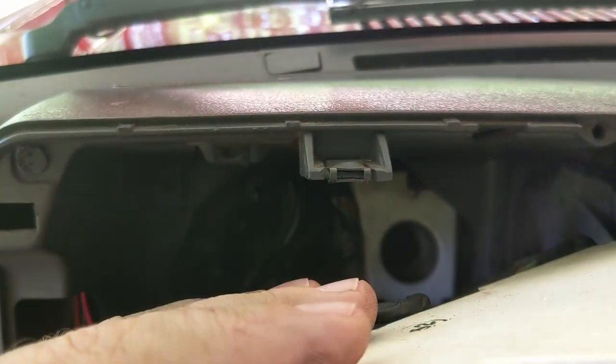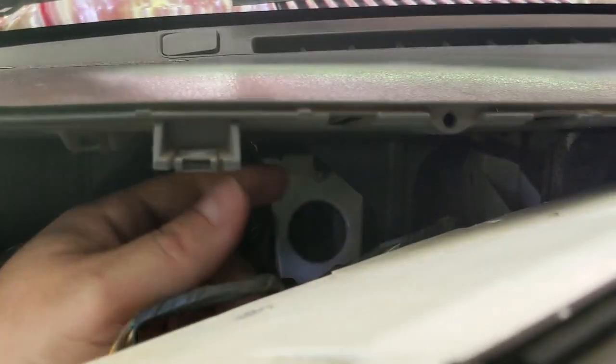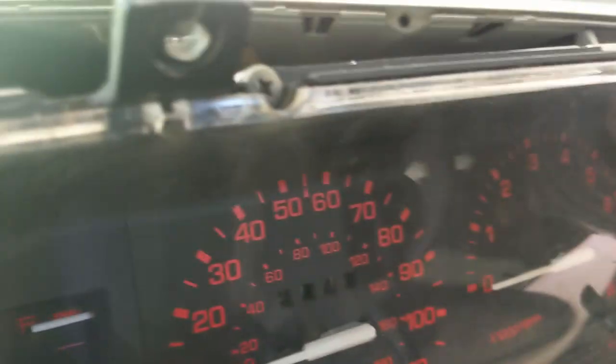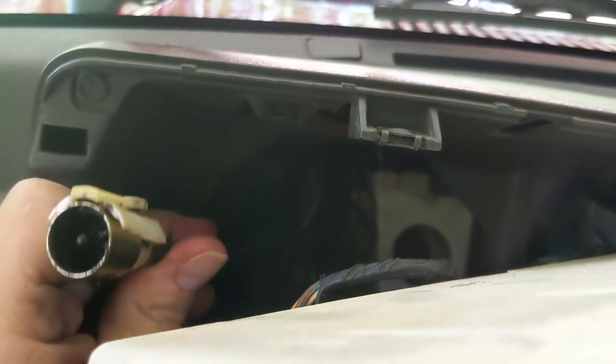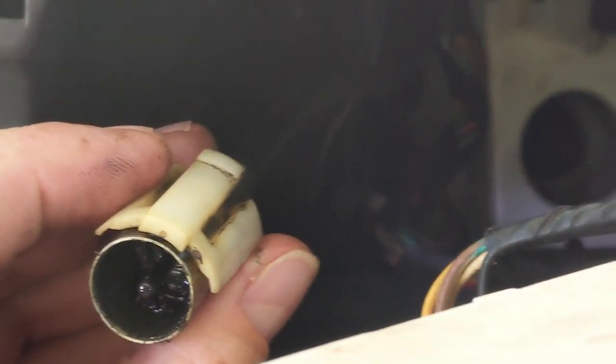Both of my trucks came with a standard gauge cluster, and of course I upgraded them with one with a tachometer. This is where the original cable came through and went directly in the back, because the speedometer on a regular gauge cluster is right in the center. But if you put in this kind, the speedometer is offset — it's over to the left — and that's where the cable needs to be. What you're going to have to do is route it around this. If you have a speedometer cable and it's going to be right here, you'd get a coat hanger, make a small hook on that end, push it backwards, hook it, and pull it over to the left. And that's how it works good and without ever breaking.